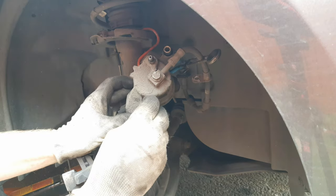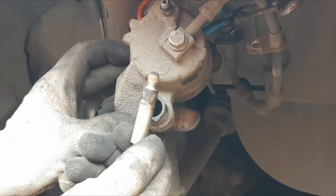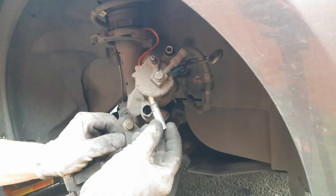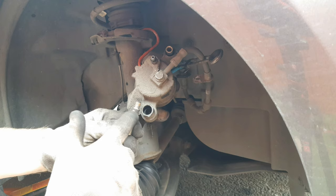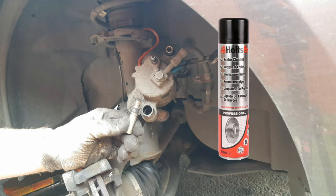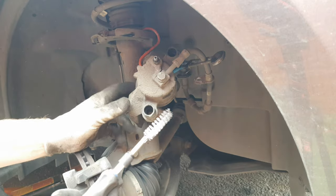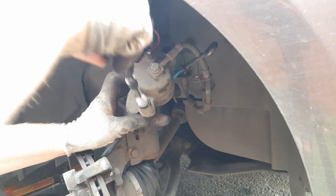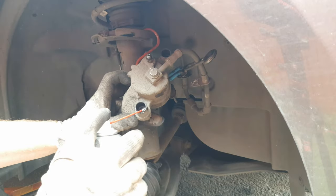While the caliper's hanging up, pull the slide pins out of their rubbers. This is the first time this car has had new brakes since it was new — you'll see that the slide pin is quite dirty at this end, which works against free sliding in the rubber. Give it some brake cleaner and clean it up with a brass or steel wire brush. With a nylon brush and some brake cleaner, give the insides of the pin rubbers a good clean and wash any dust away.